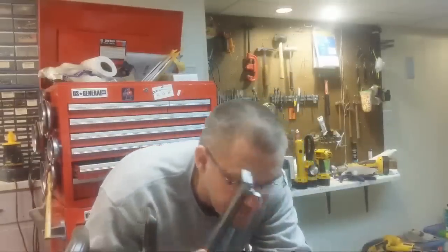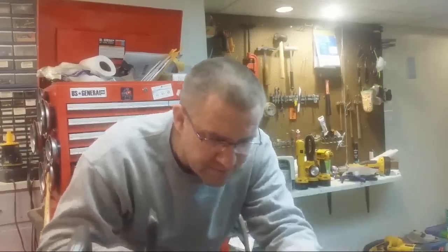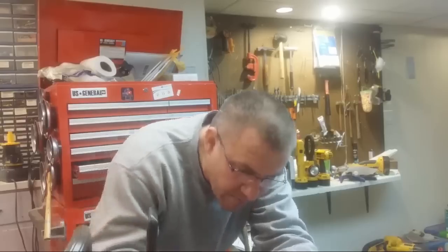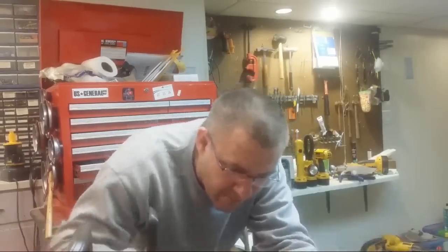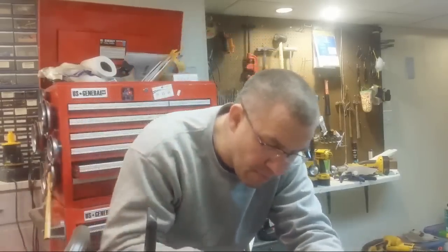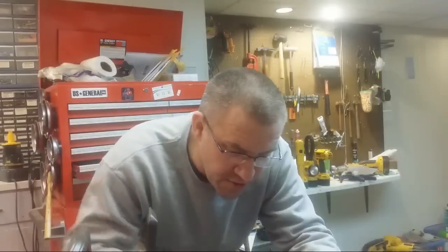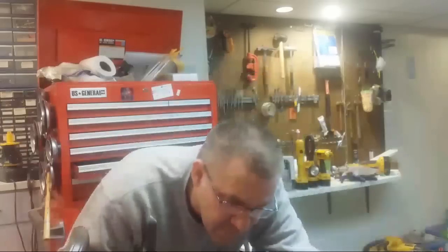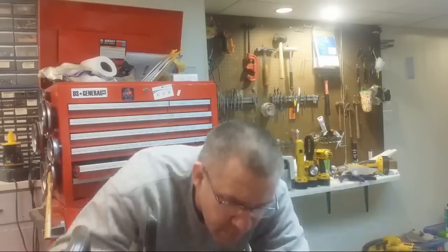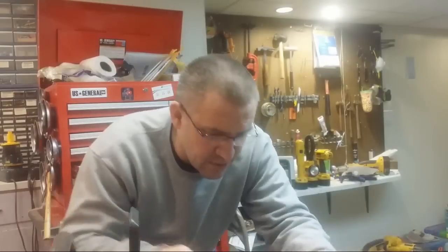You know, when you get the right file, these Oregon chains just cut like butter. Beautiful. You can feel it, like perfect. And then you get a hard one. What the heck? There we go. That one cut like butter. That one was a little hard. That's better. All I'm trying to do is get a little more hook angle on here than the grinder left. There. It gets hard and this gums.